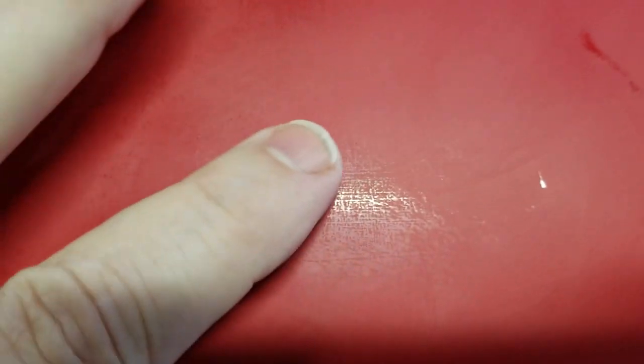Here's another close-up between sanding periods. You can see this area looks nice and shiny, but it's a little rough by looking at the way the light breaks up. When you get your first coat of sanding on there, the wet sanding knocks off the tops and you can see a lot better where you need to go back and sand. When the whole area is dull like that, you know sanding is complete — but if you wipe it dry and still see high and low spots, having a light overhead is really helpful to identify those spots.